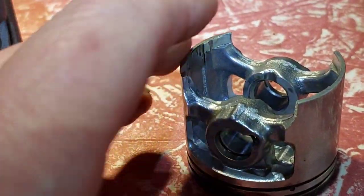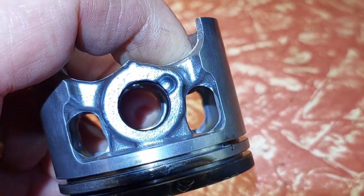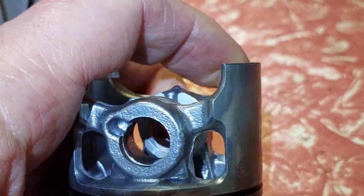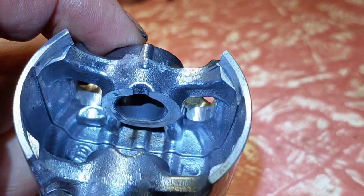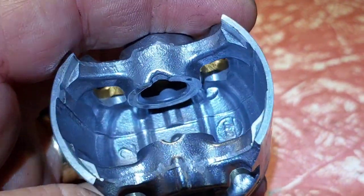Forgot to show the piston — the piston windows have been opened up just a bit so it can breathe a bit more. They were a lot more restrictive before and a lot of flashing, a lot of crap, but now it can breathe. Clean up the stuff inside — it's working good, really good now, more air flow. It's not heavily ported, just a mild port, but it'll work good.